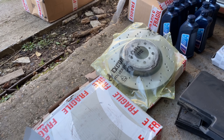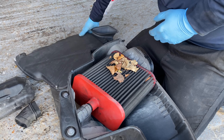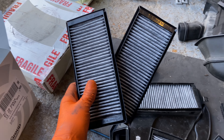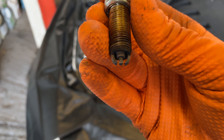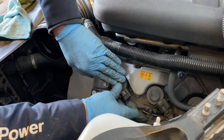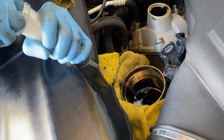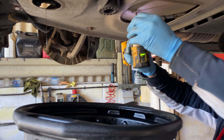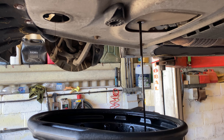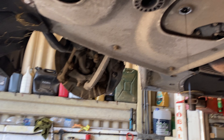We used all genuine BMW parts for this service - discs, oil, spark plugs, and all filters. The air filter had leaves in it, so a fresh one went in. Cabin filters swapped out with genuine BMW ones. Spark plugs pulled and inspected - didn't look too bad, but with the plenum already off we swapped them anyway. For the oil change, we remove the filter housing and suck out the old oil. Importantly, the E92 M3 has two sump plugs - one at the back and one towards the front - 25 Newton-meters on both. Then fresh 10W-60 genuine BMW oil goes in.